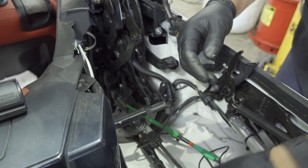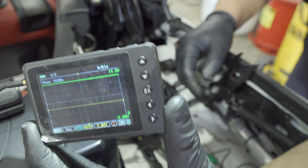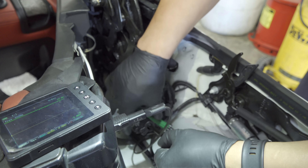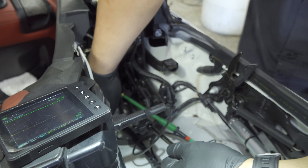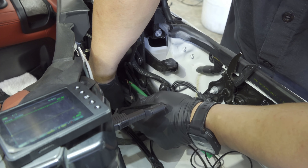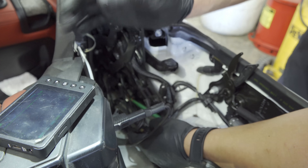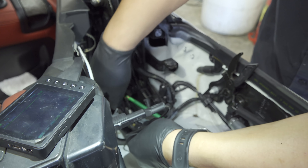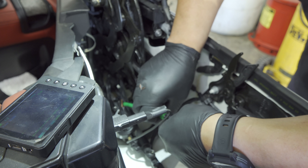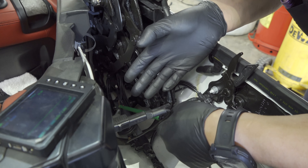I am going to leave this here — you guys are seeing that it's at 12 volts. We're going to keep an eye out for any changes; I'm going to move this strut and see if the voltage changes. We've got zero change to that waveform at all. It's not supposed to be 12 volts according to service information. I'm going to check my ground — knowing that we have 12 volts at one wire, if we have a lack of ground supply, I'm hooking up to my brown wire now.